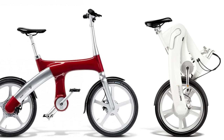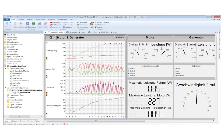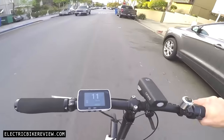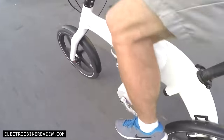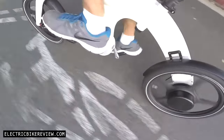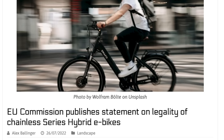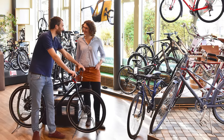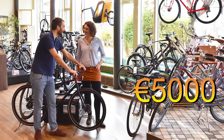Part of the issue is the software. If the controller uses basic algorithms and cannot control the motor quickly enough or provide appropriate feedback to the rider through the generator, the digital drive will not feel natural. One reason why the Mando Footloose is the only digital drive bike available is that the German approval body for e-bikes has until very recently classified digital drive bikes in the same category as motorbikes and mopeds, rather than as a bicycle. German bicycle shops attempting to sell the Mando Footloose even risked a 5,000 euro fine.